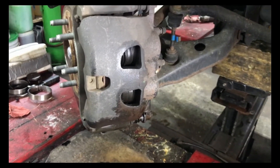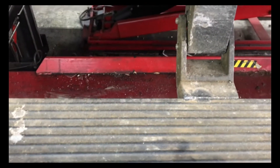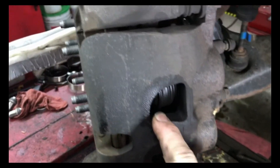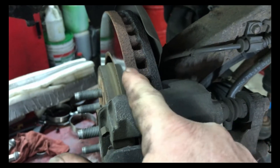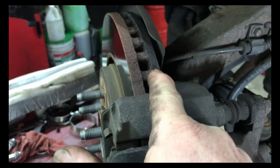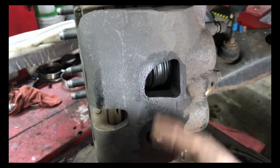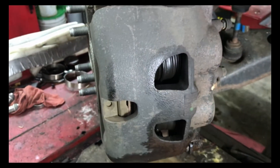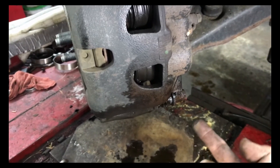As you can see, there's rusty metal on the side step from the brake rotor where the inside pad was hitting the rotor. You can see the thickness of the rotor is a lot thicker on one side and thinner over here. He ground down the inside brakes, then the pad fell out. Once the pad fell out, the pistons popped out and started leaking brake fluid.